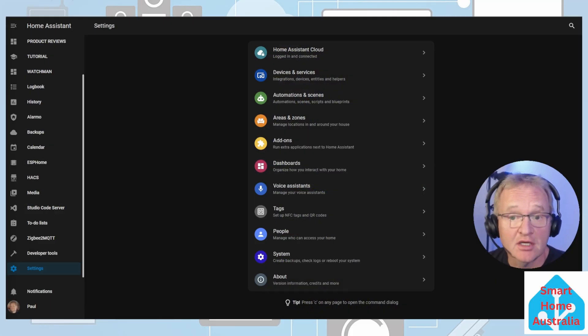We're going to cover accessing your Home Assistant instance through the browser on the NS Panel Pro. We'll use Nabu Casa for external internet access, then create a separate tile for local access over your network. The process is exactly the same for both — the only variation is the address: the Nabu Casa address for external access, and the internal IP address for local access. We'll also cover the most common errors people make around this.